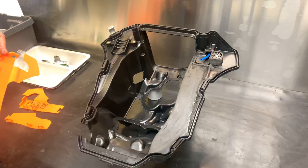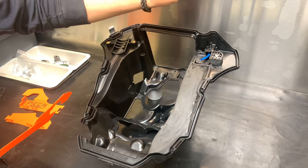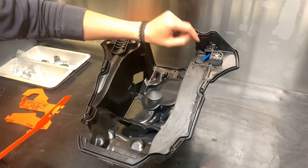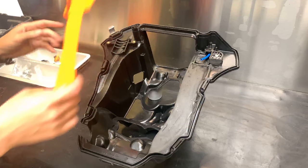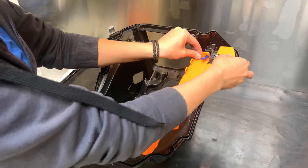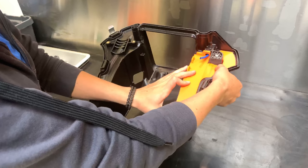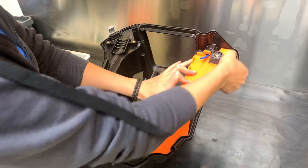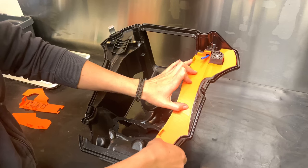So once you're done, you should have something looking like this. You have your polytube, which you have glued or not, depends on how you like it, or you have cut or not. You have your screw in, you have your grommet down here, and now we are at the 3D part. So go through there, and now this should fit quite snugly. It should be quite flexible when you printed it in the 0.9 millimeters.